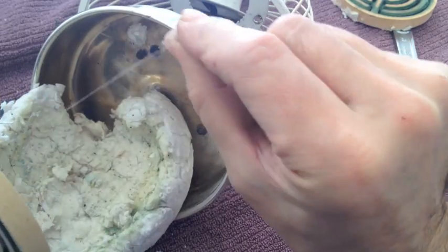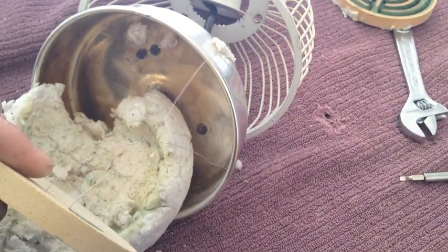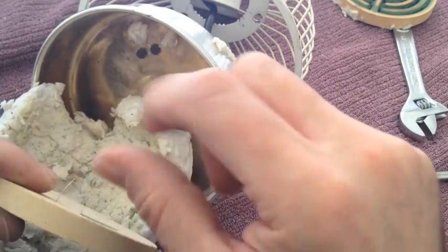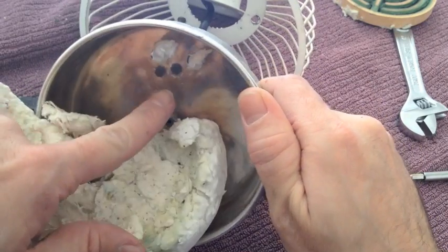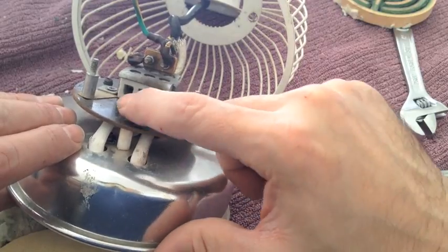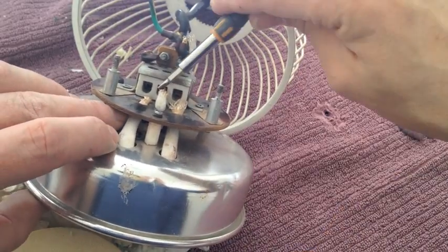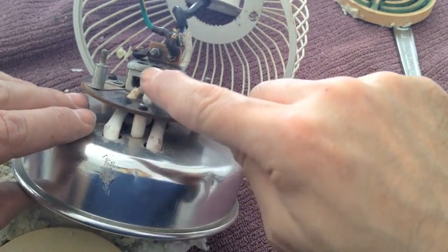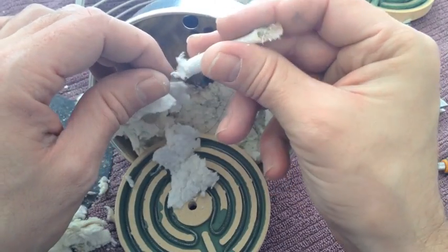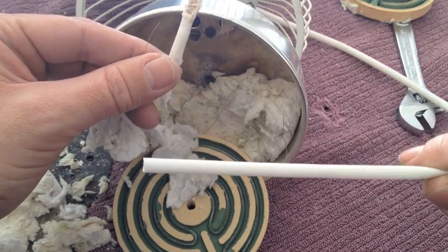Now we need to put the new heat lamp in. These wires are nice and long and they'll be much longer than the one you've taken out — don't cut them before you put it all back together, just leave them nice and long because you'll need that extra length. I usually find that putting this back in, we need to thread these wires through the insulation material here. This can be the trickiest part of the whole job because it can be a little bit fiddly getting these wires to go back through these tubes.